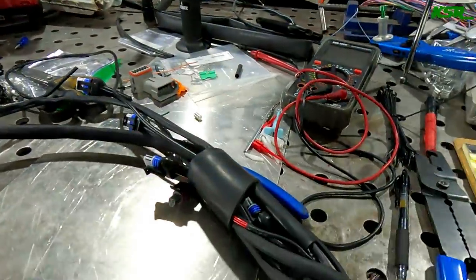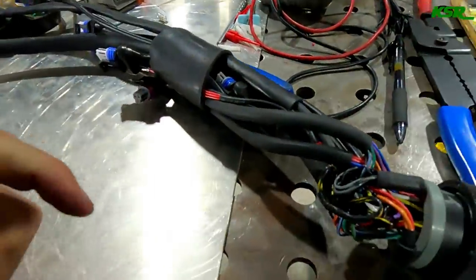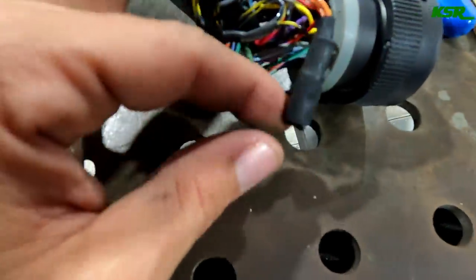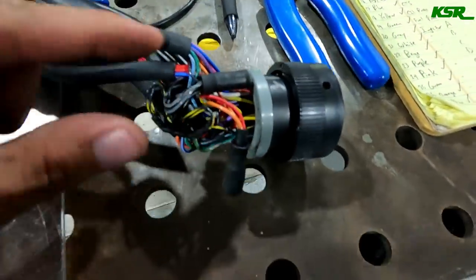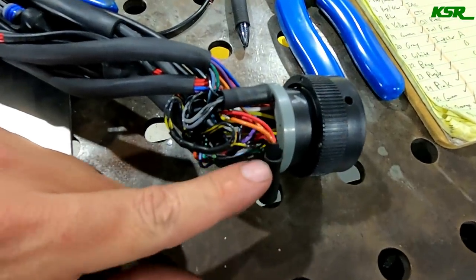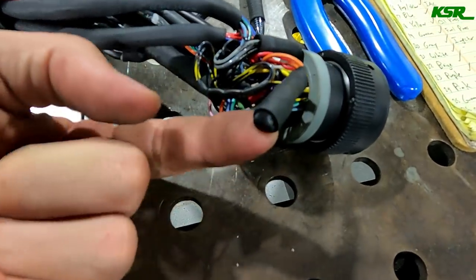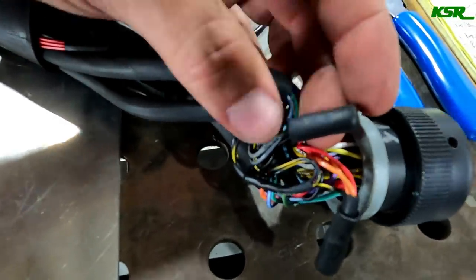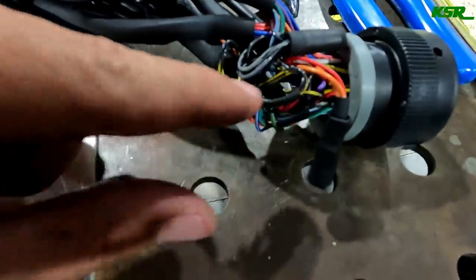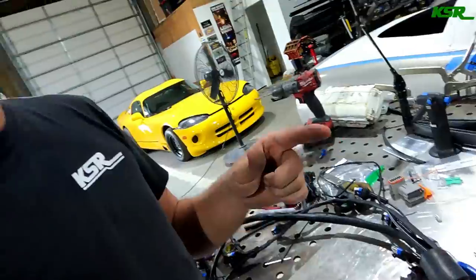This is what we've got to show for a partial day's work — I had to leave for my oldest daughter's fifth-grade graduation, which cut into the day. But here's what it looks like before final heat shrinking: there's a joint here where a single 5-volt wire comes out and loops into a connector that feeds all the 5-volt sensors — that's heat shrinked off. Same with the grounds. There's also a logic ground for all the coils with a black wire with yellow stripe.